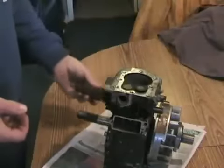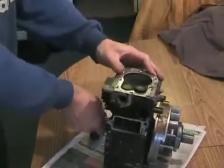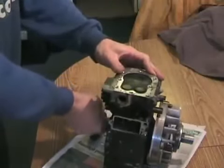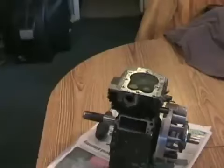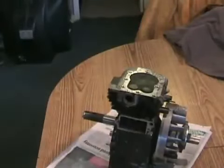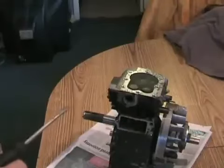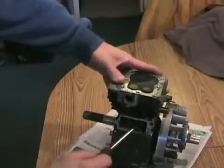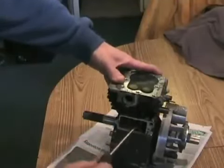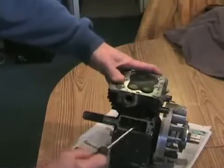How do you tell when the valve is perfectly straight? That's simple enough too. You can rotate your engine — on a little engine like this, you watch it close. If it's an overhead valve engine, the head's already off the vehicle, so you can't rotate the engine to do this. What you do is just depress the valve spring or rotate the camshaft, and that will open and close the valve. On this motor, I can just push the valve spring and it opens and closes the valve. I'll show you what I'm looking for when I straighten the valve to tell if it's perfectly straight or not.